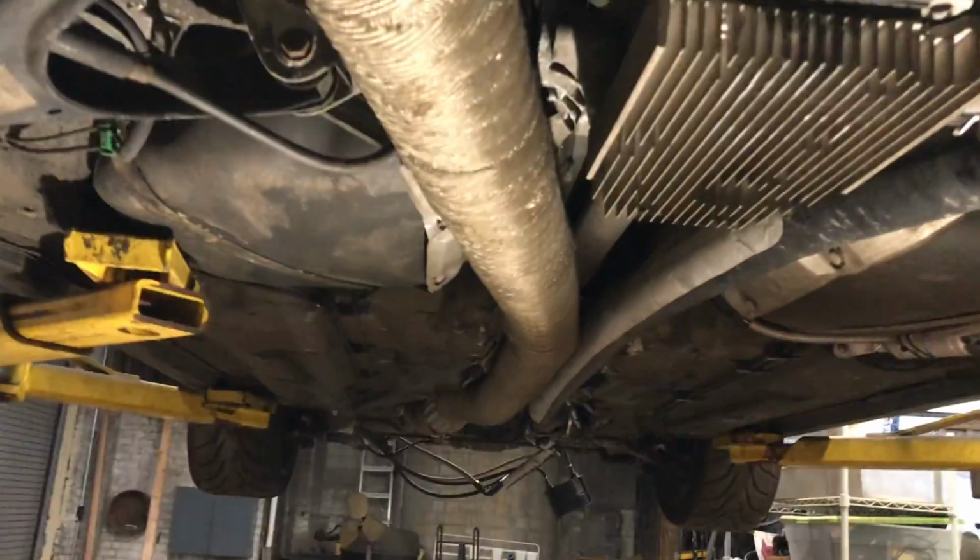So the hot side is pretty basic. 4-inch pipe comes back, splits to dual 2.5s, and feeds the two turbos. Here's the hot side turbine feed, and then it goes around the turbine. And then this is my exhaust tip, and this is one of the cool things. We look in here. That's looking into my exhaust, which is kind of neat.